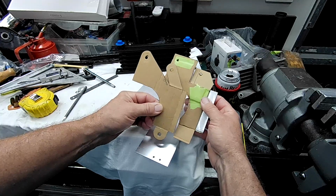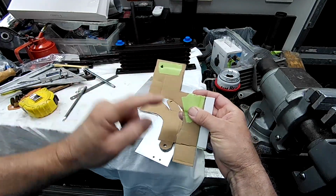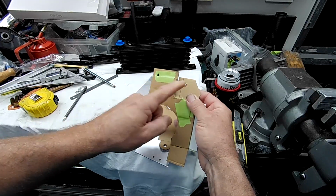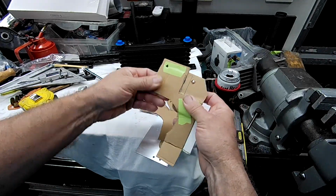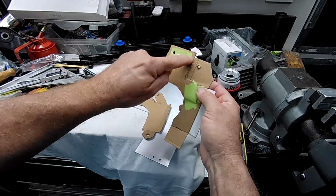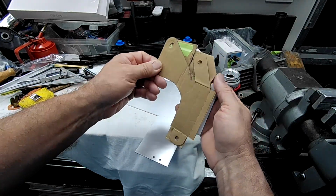I've made it a little bit wider here and trimmed it down there, and the biggest issue I was having here was this narrow piece across the center not really being wide enough and carrying enough strength. Because I needed to fold down and get a fixing up underneath from here, it's like, oh, what am I going to do there? So I figured out if I just cut this on an angle, go across, that'll still fold down, give me a bolt fixing, but it'll give me a wider section here, which is what I've done.